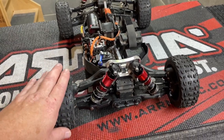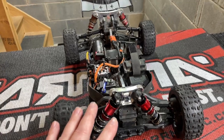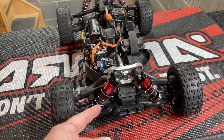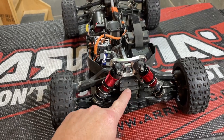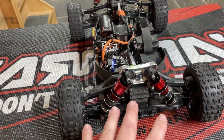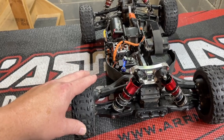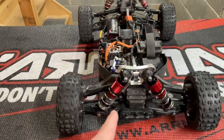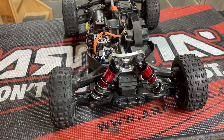This has been my main jumping car — I'm trying to set a personal distance record. So far this summer I've hit 210 feet and I'm trying to hit 250-plus. I needed to go through the front differential because the rear is working great but the front is too loose. When I'm in the air and hitting the gas trying to get up to 85-90 mph at the ramp, too much power is going to one wheel because the differential fluid is too thin. I want to thicken it up so more power goes to both wheels equally, and stop the ballooning that's blowing tires off the rim.